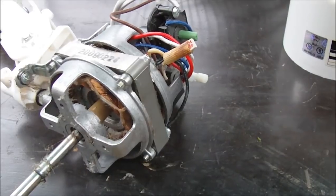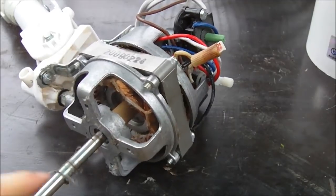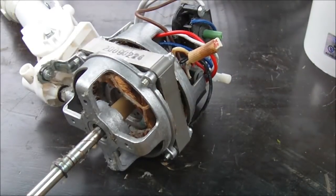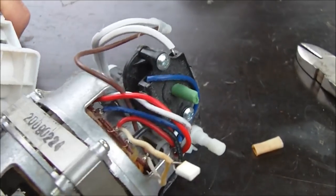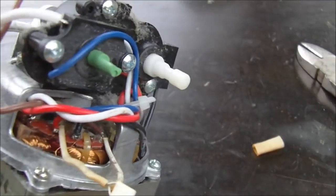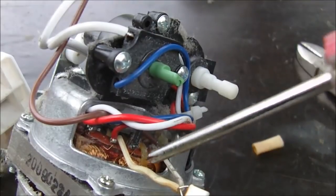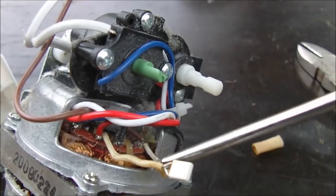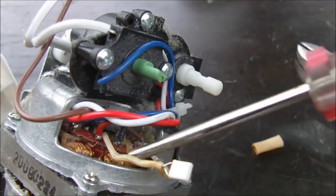See if the motor has torque. If the motor is weak, or it just turns and stops, then the motor is basically garbage — there's just no point in trying to repair the coils. It's way too much work unless you want to take it all apart and repair the burnt coil, but that's kind of ridiculous. So we've determined that the thermal protector is the problem — very simple. We're going to have to unsolder it, cut the wires, join the new thermal protector, solder it, cover it with the insulator, tape it up, and make sure it's well insulated.